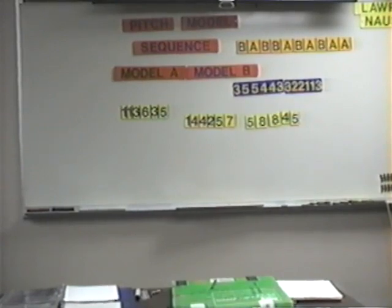Only Goodyear people would have been able to easily pick out the pitch pattern on that, right? Otherwise, it's pretty difficult to see anything. That's right. But can you see the size of those lugs changing now that you know? Yeah, you can see them changing. It's just that there's a single lug and then an upside down U, and a single lug and upside down U. You wouldn't know looking at it whether to go from one single to the next as a pitch or to skip one. And only Goodyear would have been able to do that.